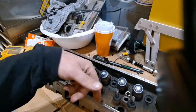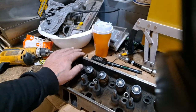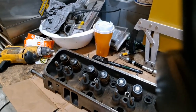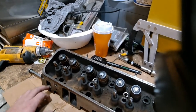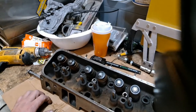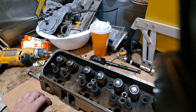When I had the valves out, I cleaned a little ridge around the throat of the valve. So I didn't do really any porting of the chambers. May end up gasket matching these when I get the intake. I've got cylinder head gaskets coming that have a compression thickness of 15 thou. I'll boost up my compression.